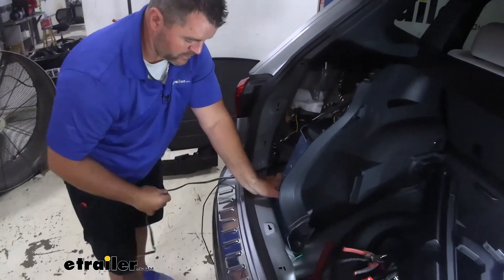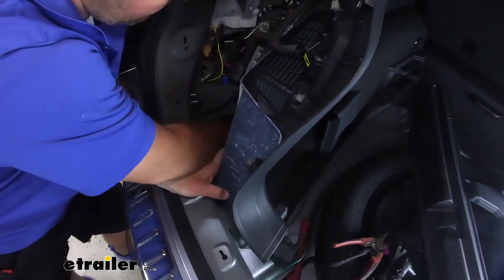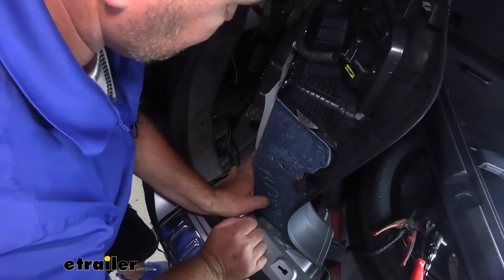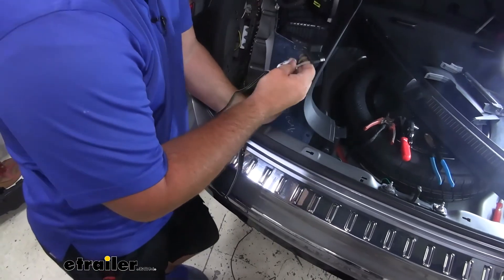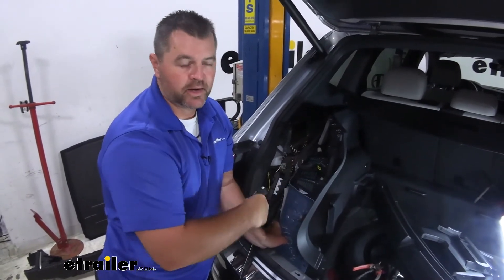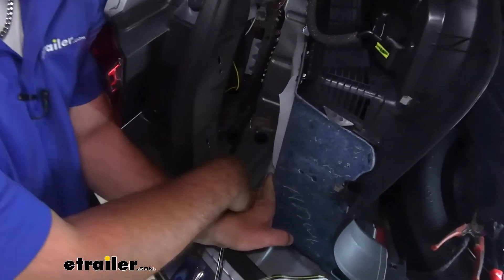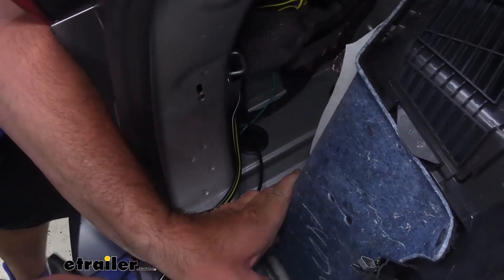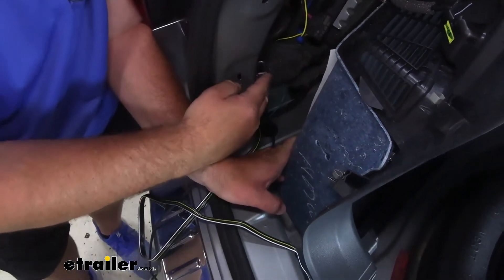We're going to take our four-pole wire, our black wire, and our green wire, and go down and come out through this bottom hole as mentioned earlier. The green wire we're just going to lay across and it's going to go over to the passenger side. We need to get our power wire outside the vehicle. Our customer actually wants the four-pole right outside, so there's a grommet right down here in this bottom corner. We're going to pop that grommet out, feed our black wire and our four-pole wire down through there, put a slice in the grommet, and slide it back into place, then seal it.